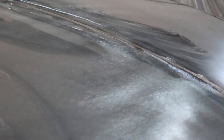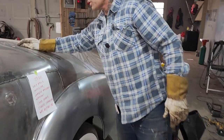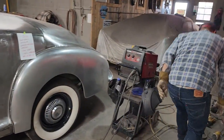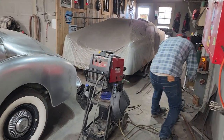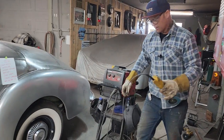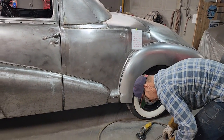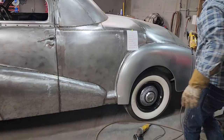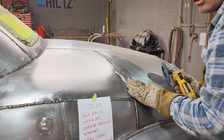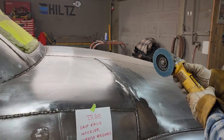That's hot. Now, I got that ground off fairly decent. I'm going to leave it like that, and it's quite scratched up like that, but I'm going to take a flapper wheel. I've got an 80 grit on a flapper wheel, and I don't generally do this all the time for every car before I fill it. I'm doing this one because I'm going to polish it, and I want to make it look fairly decent. If you're filling something, that'd be great. You grind it off, maybe clean it up with your drill, and then you would go for it, and that's a perfect adhesion. But where I'm leaving it like this, I probably want to make it look the best I can.